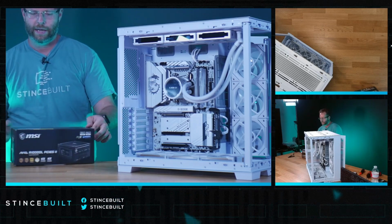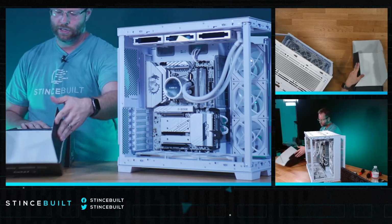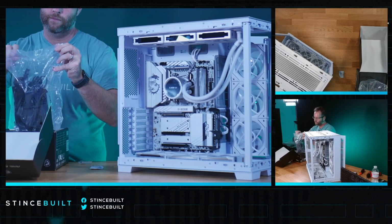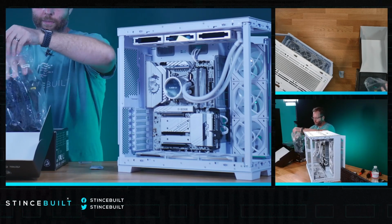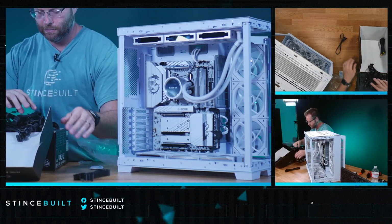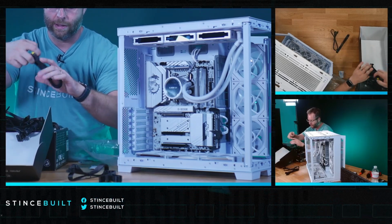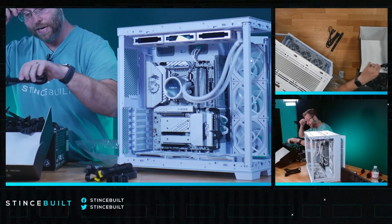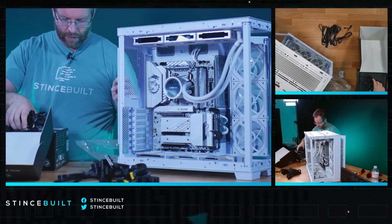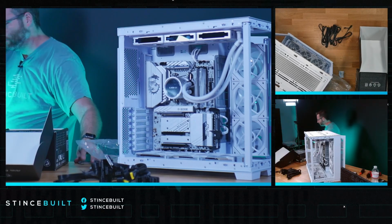1,000-watt power supply today, guys. MSI 1000 GL Gen 2. Well, black cables today. Normally I opt for the premium power supply in white, so we have the black cables today. CPU, 12-volt high power for GPU, SATA, PCIe, and 24-pin main. A lot of cables right there. All these other cables in the power cable box, we're going to motherboard.